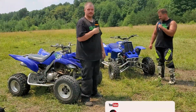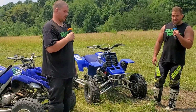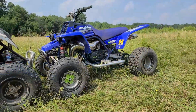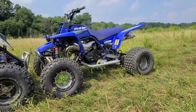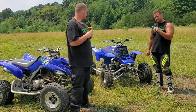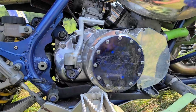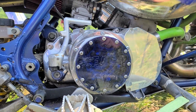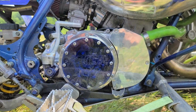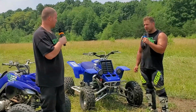Crazy build, but sport quad guys know that the stock Banshee just screams. They're really hard to beat. This one is a 421 stroker, the 4mm, as people like to call them. It is not ported. It has Driveline Assassin cylinders, but it could definitely make some more power. I would say it's like a mid-grade 421 build. I would estimate it's probably got about 80 horsepower. I was thinking 85, but it's somewhere around that. It runs on 93. It does not have race gas. Wow, pump gas at 80 horse, man.